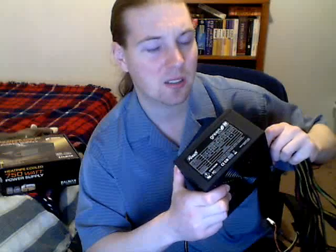So with my previous power supply before this, it was a Thermaltake 500 watt. That died because it was just kind of shaky and old. This 430-watt is okay with my five hard drives, as long as I'm not going to start playing games. The 500-watt had an external 5.25-inch bay that would tell you how many watts the PSU was drawing, and on average use it would be upper 300 to low 400 watts — it really wouldn't spike that high. So this PSU was fine for work-only purposes.